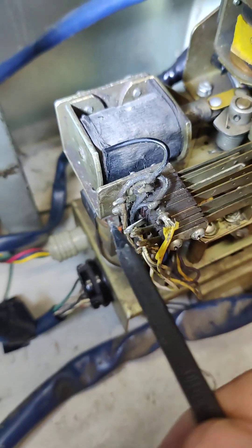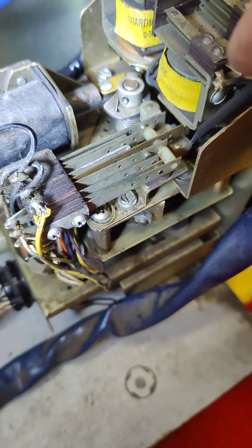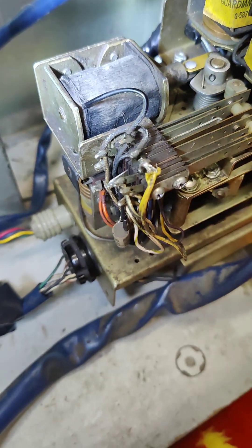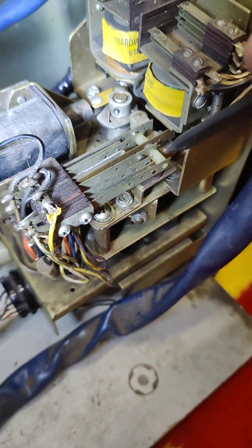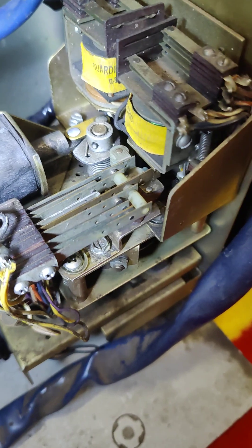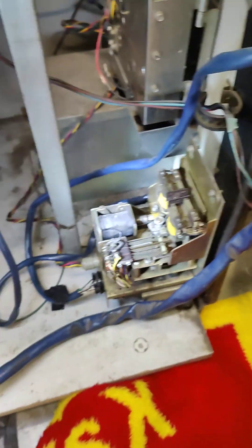You may want to put your meter on that switch — put one probe down here on the positive, put your negative back here on the switch. Just manually operate the solenoid and make sure you're getting good make and break with that contact pad.